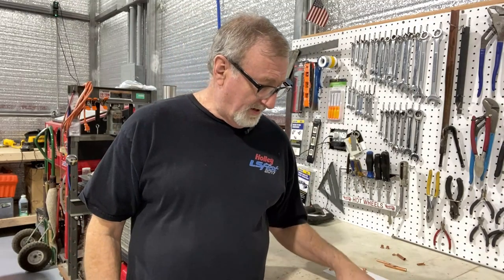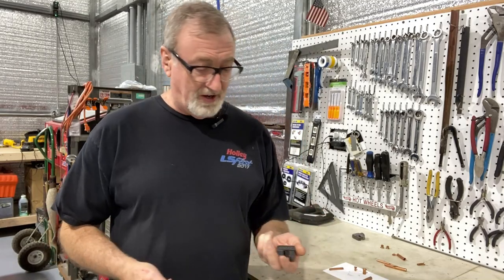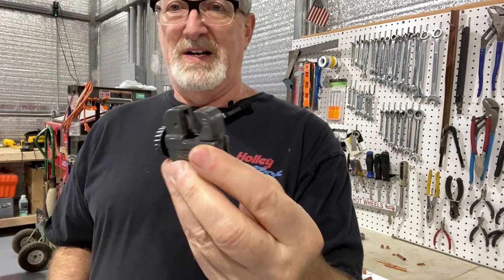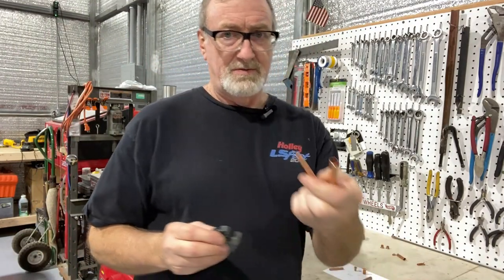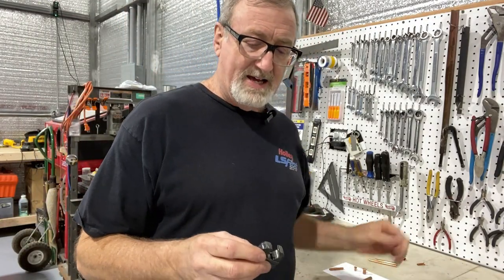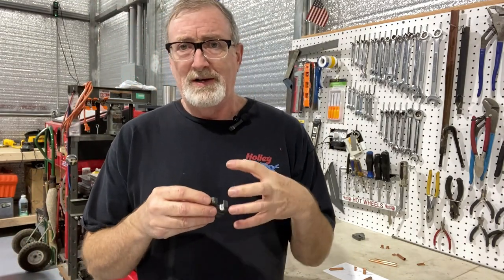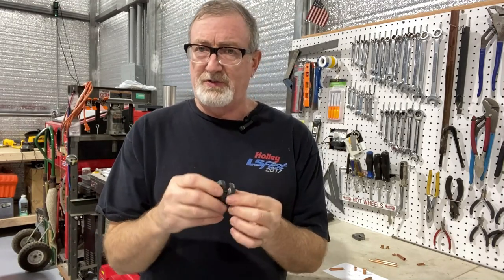When you're dealing with cutting the tubing, I've got several cutters here. These two are actually the same size, so I'm going to put one aside. It's pretty nice, but it's small. The size range it covers is 1/8 to 3/8 overall diameter. When you're dealing with lines such as this tubing — this is a quarter inch and a 3/8 inch copper — as small as it is, it is easy to get into small places. So if you're working on your car and you've got lines in there, it's easier to get it in there. However, being as small as it is, it's also a little more difficult to handle.